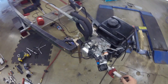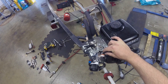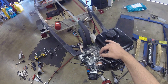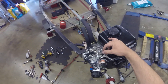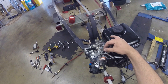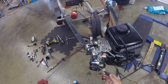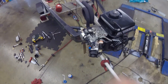I read that you can do a GX390 carburetor swap on these using adapter plates from NR Racing, and Affordable Carts listed a direct bolt-on 390 carburetor for 240 or 270cc engines. I figured I could use a 390 adapter and put a 10-horsepower 270cc carburetor on there. This adapter works on the 240, 270, 390, and should work on the 310 Predator too.